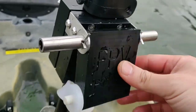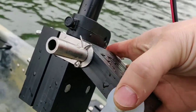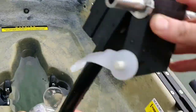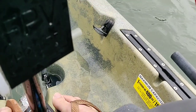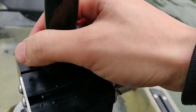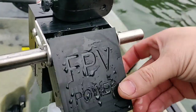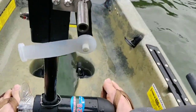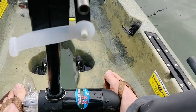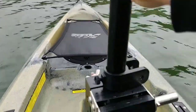See how it pivots? And this is the actual part that gets locked in, the top pin and the bottom pin that lock into your drive well, and this thing just pivots freely. This part on top is just the locator from the stock motor setup, just a locating collar. So let me put this back on again. Let me take a side view. The motor on my right foot, that's the front of the motor. So when the motor hits something, this whole thing pivots like so. See that? It pivots, and it gives. And the spring-loaded silicon is the tension.